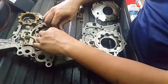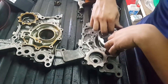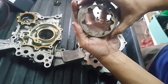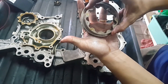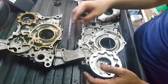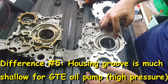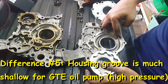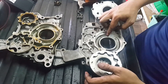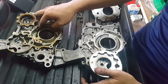The housing on the NA pump is smaller, while the GTE housing is so much bigger — you can see that clearly from behind. Furthermore, on the GTE pump there is quite a deep cut into it, whereas the NA pump has two shallow parting lines. The GTE groove is slightly deeper and slightly narrower, while the NA one is bigger.